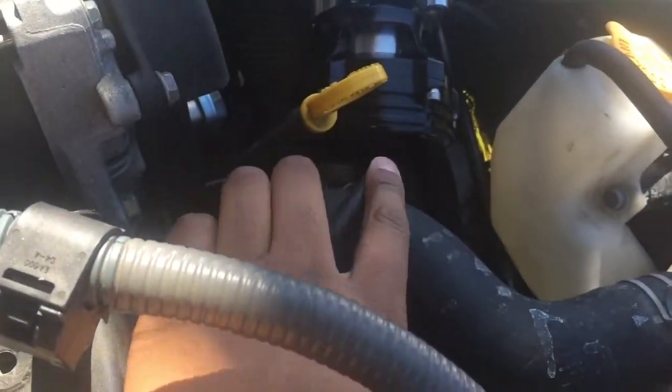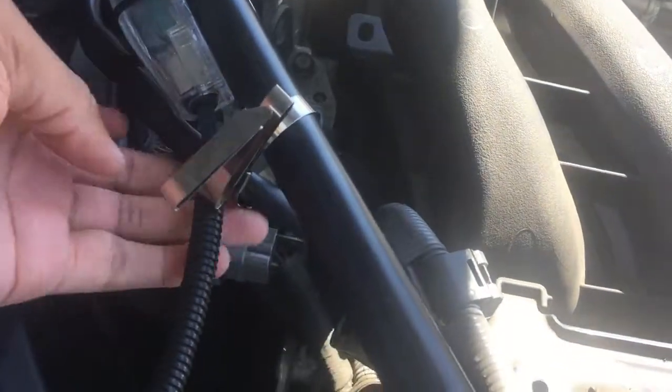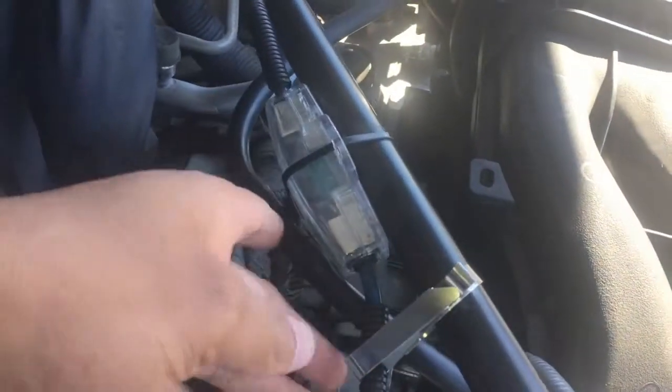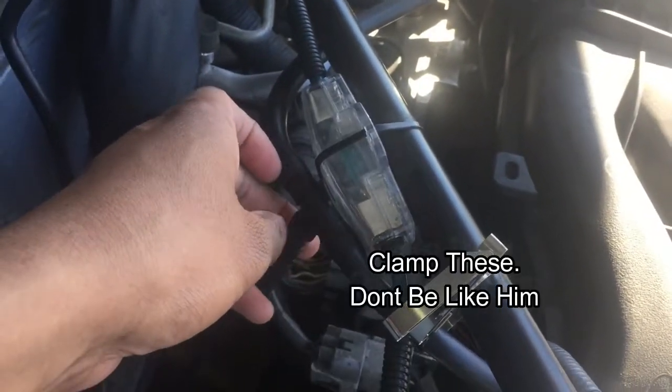But as you can see, I have it coming off the line from the blow-off valve. I routed that under the intake manifold, and then that line goes straight over here to the vacuum hose. That comes out over here, whatever. Now, off of that, I put a T, and I teed it off, cut through the blow-off valve wire, teed it off, and then ran it straight down through where the sound tube plugs into. Maybe I can show you in here. I don't know if you can see that, but you should be able to see it goes right in there through that hole right there.